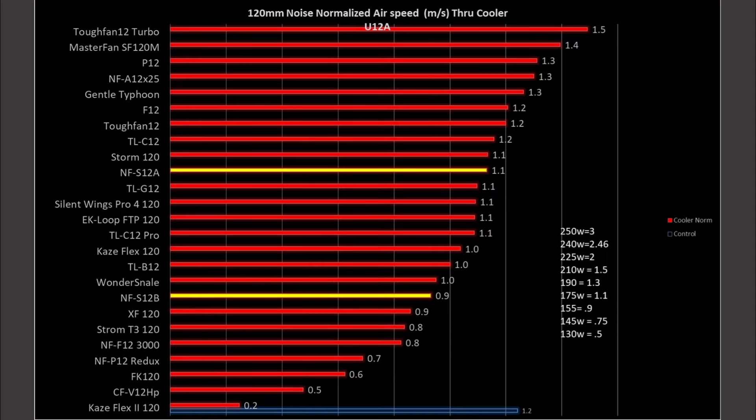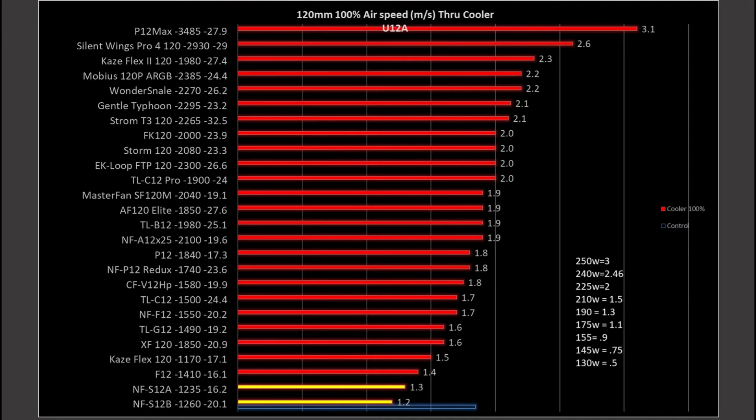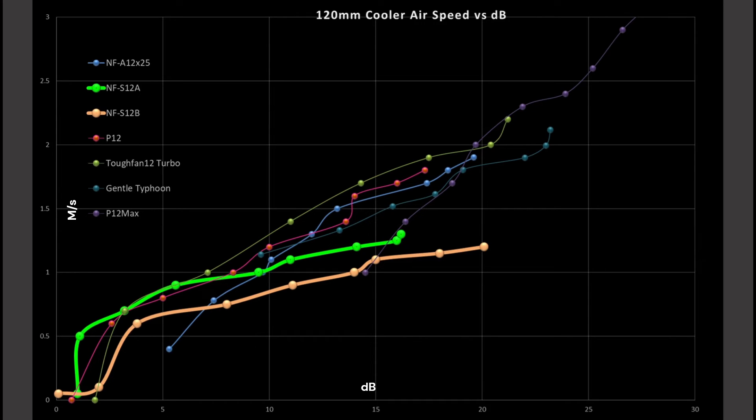How do they compare against other fans? This is a small subsample of all the fans I've tested, with top performers, some middle performers, and some bottom performers selected more or less at random. The S12A is kind of surprising in its position, while the S12B is nothing special and can largely be ignored. At 100%, when we're letting the fans go flat out, the S12A and S12B are at the bottom of the graph, but also note their RPM — they're spinning much slower than most other fans. Looking at cooler performance, airspeed versus decibel reading, they just kind of flatline, not very efficiently, while other fans tend to climb steeper. These fans clearly just don't have the pressure application to handle it — they get significantly noisier without giving much more performance.